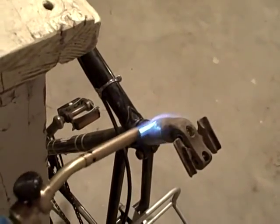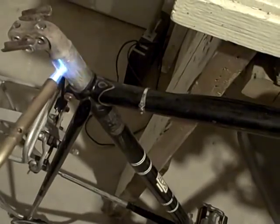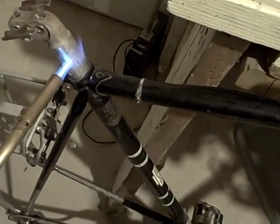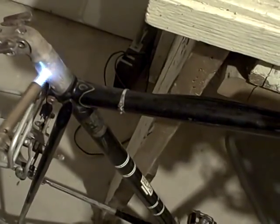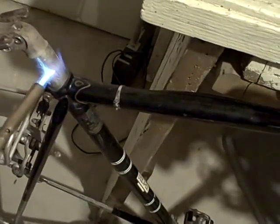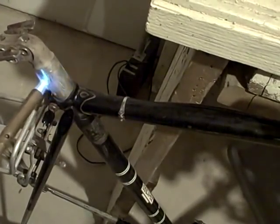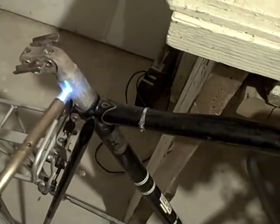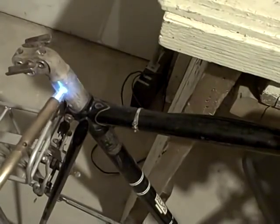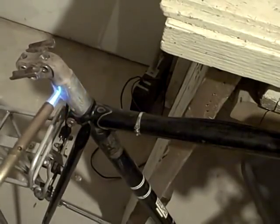The whole basis for this is that your metal of your seat post and the metal of your seat tube have two different compositions, so they will expand and contract at different rates. Also, whatever is holding them together in there — be that rust or whatever — this was a bike I bought to use several years ago and no one's been able to get it apart. My dad had it for a while; it fit him pretty well so he didn't move the seat. Now we're trying to get the seat post down. What you'd like to hear is some clicking noises — basically the same thing that happens when you hear pipes clanging in old buildings, which is the metals expanding and contracting at different rates.